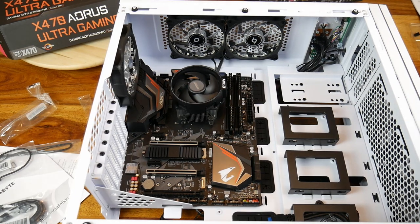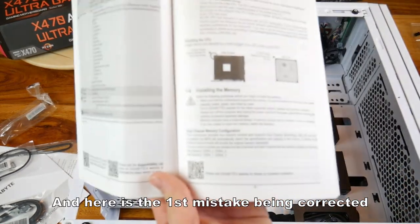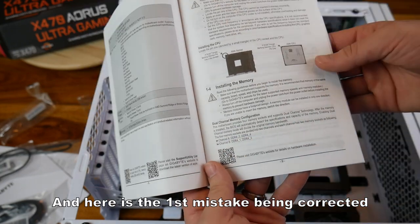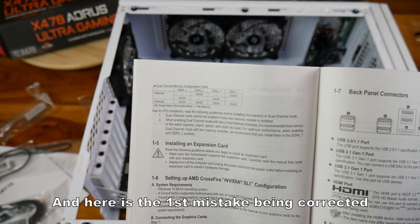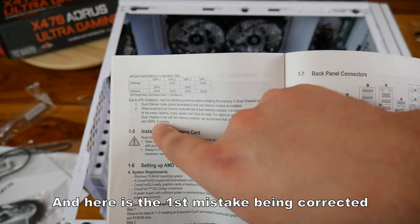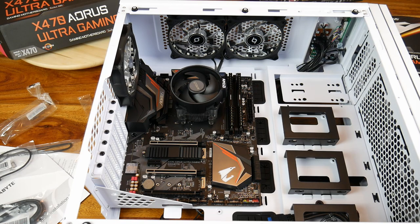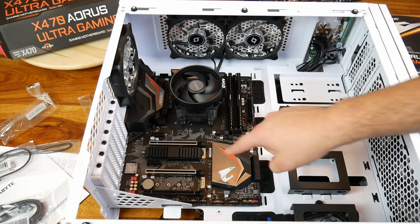It's the next day from the last clip — I had to stop building yesterday. I apologize also for the birds squeaking as I'm talking. Earlier in the video I said about the RAM slots — the manual states slots two and four, which is what I thought. But if I flip the page over, right at the very top there's a diagram: when using dual channel mode, we recommend DDR4 slots one and two. So I have now moved the RAM into slots one and two. That's everything installed.